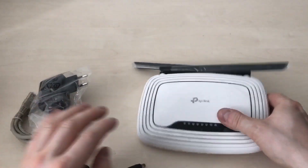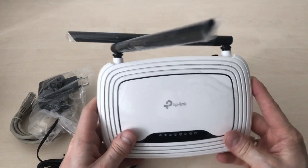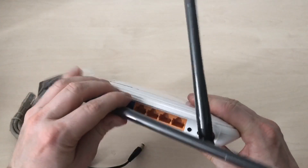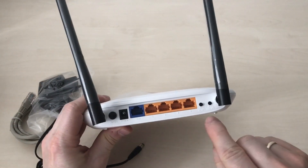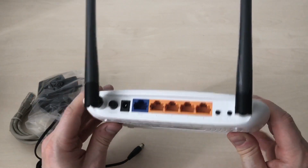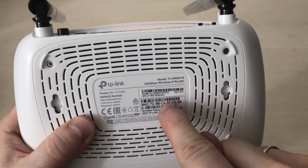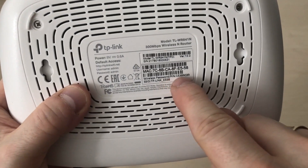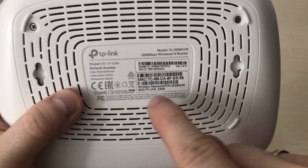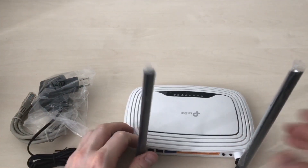Important notice: when you buy a new router you don't have to put it to the factory settings, but when you got it from home or from your neighbor and the router was already in use, you must reset it to factory settings using the small button on the back. On the router you also find a small label with the wireless network name, the wireless security key, the address for the router's home page, and the username and password.